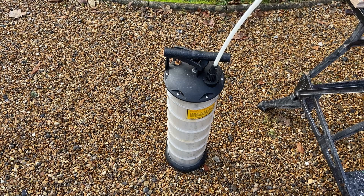The only problem I've had with two cars — one was the SL55 where the sump was split into two parts so going in through the dipstick tube you couldn't get all the oil out, and the other was on the Polo. The reason is the Polo's dipstick tube is very narrow, only about five millimetres in diameter, and the tubes that came with my fluid extractor were too large. Fortunately I found an online site where I could buy a four and a half millimetre tube that also handily fitted onto the wider six millimetre tube on my extractor. I'll show you that now.